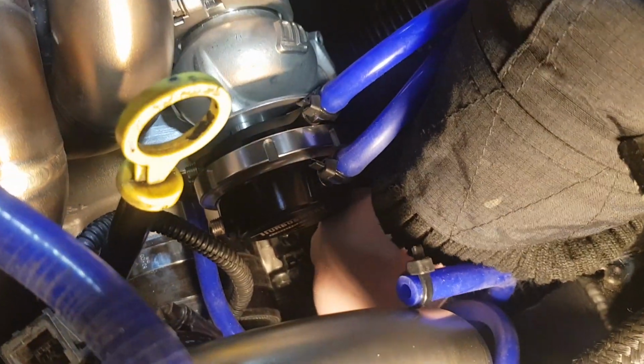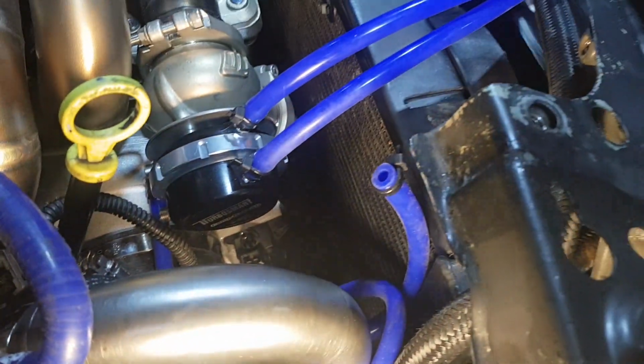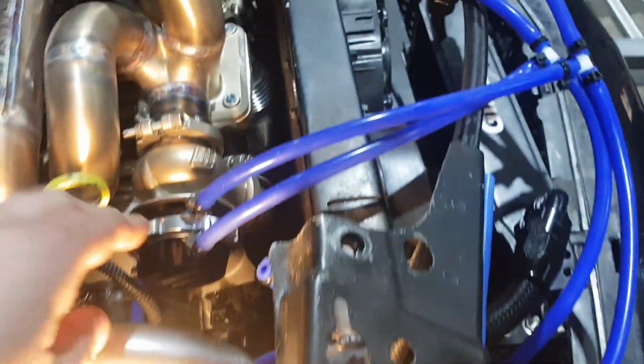Cool. So this is why we didn't do it hot yesterday, because now imagine your hand on that hot wastegate and this hot water pipe and that radiator, all burning yourself while you're trying to do that. This is why we left it overnight. But let's hope this is what fixes it. We know this solenoid worked on your old turbo. Yeah, definitely. So we'll change it over anyway and hope this fixes it, and if not, further investigations. We've checked all the vacuum lines again, there's no leaks. Check the wastegates are all tight and stuff, there's nothing wrong with them.